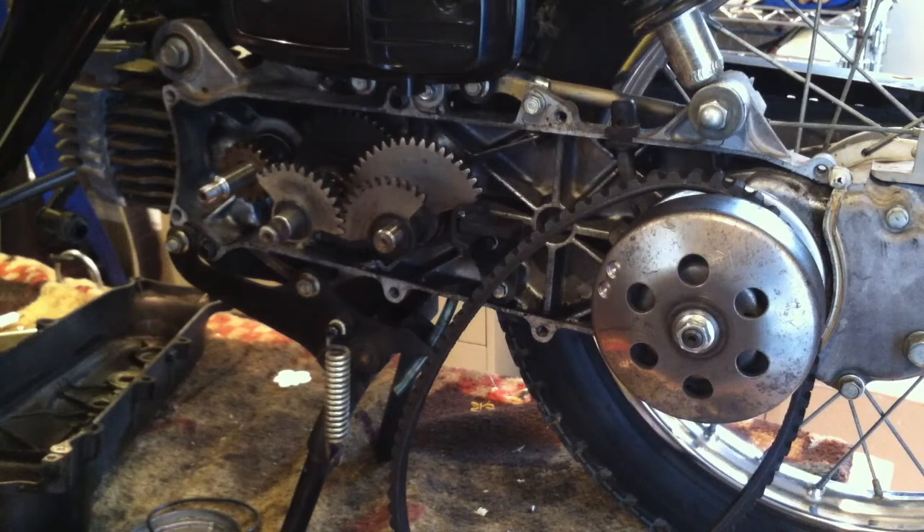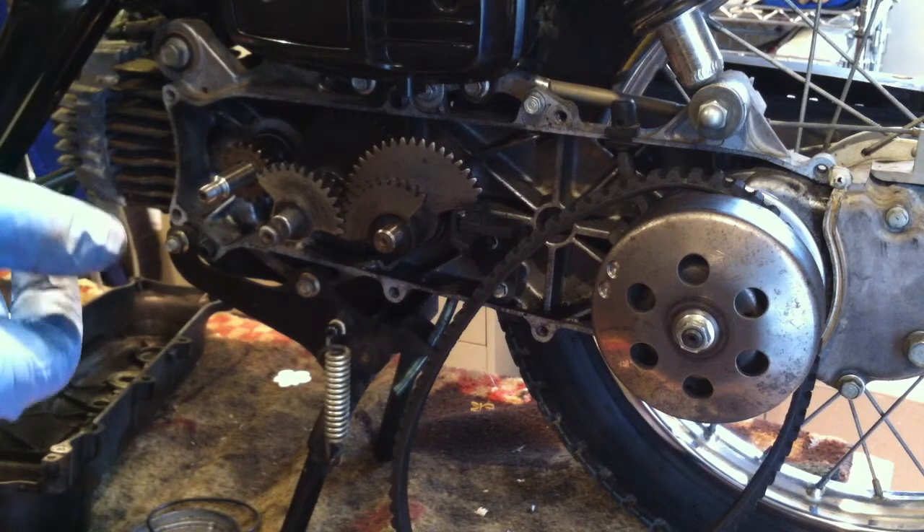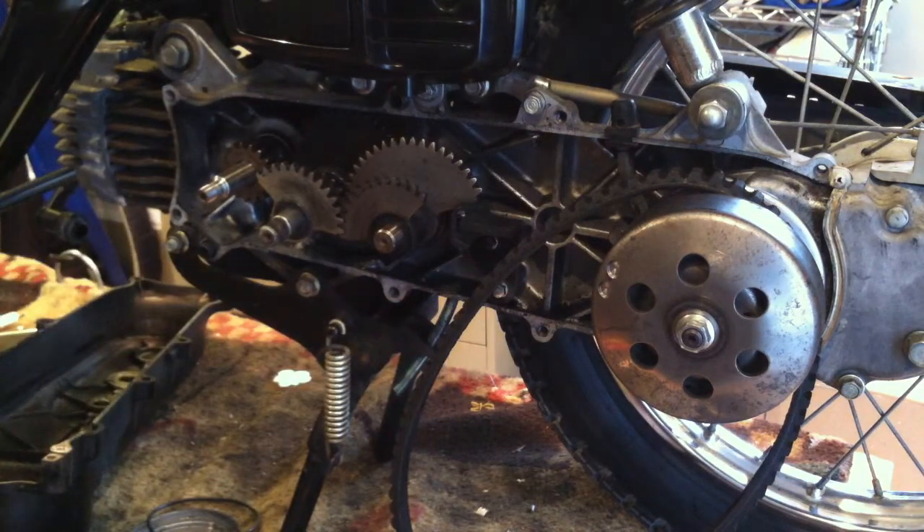Hey, welcome back. The Bone Crusher got shortchanged — he got stuck listening to a lecture about carburetors and didn't really get to enjoy his new bike. Generally on a new carburetor, the rubber tip is not going to get hard. We're not talking about a 36-year-old carburetor — maybe a three-month-old carburetor. And if you need a bigger idle jet in the carburetor, you've got some other problem wrong with your bike. I'll send a bigger idle jet and take care of that carb problem.